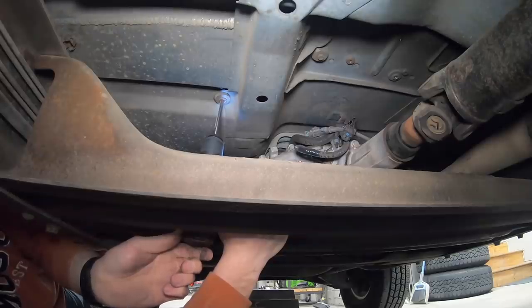You've just got to make a small hole through the sheet metal so you can get a bolt threaded in there. It will be a little bit tricky to drill up through there without damaging the threads, but if you're careful - make a pilot hole from the bottom up and then drill the rest of the hole from the top down. The front mounting hole right through there has no metal boss or big giant threaded insert welded onto the bottom of the floor pan, but they were nice enough to make a little tiny dimple in the bottom of the floor pan that gives us the location of where that mount needs to go. I'll just drill a hole, run a bolt through there, and put a big fender washer on the bottom for a little extra reinforcement. All we've got to do really is drill a couple of holes and get these seats bolted back in the Suburban.